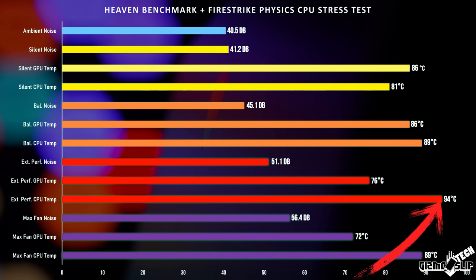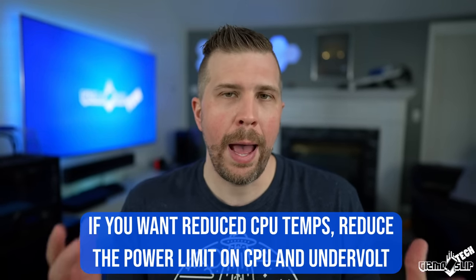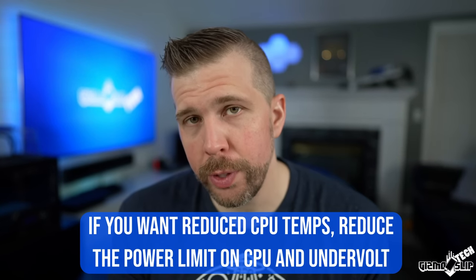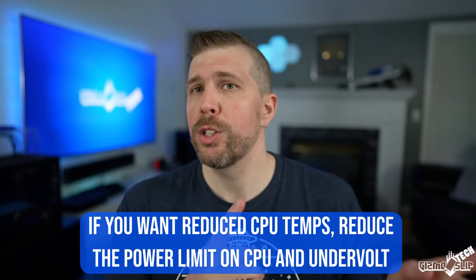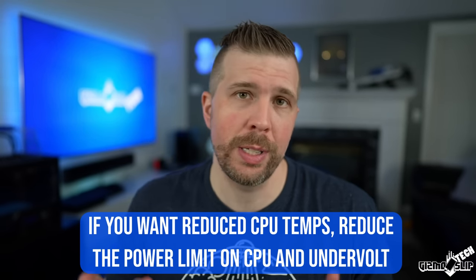Now, there are obviously a number of things you can do to improve this. Running your fans at max fans will drop your temps down to 89 degrees. Another great option is going to be undervolting your CPU. If you want to know how much the temperatures drop when you undervolt the CPU, be sure to subscribe so you don't miss out on the 11th Gen Intel undervolting guide and results.